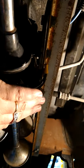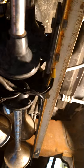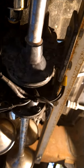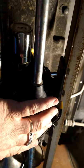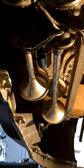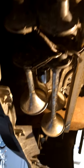It's wired back up real simple. Both of them, you just run the ground wire to a ground point right here, and then the two positives I have running up to a relay. The relay goes to the factory horn positive, so the factory horn sounds and all of these sound, and you get true battery power from the relay — you're not going to starve the horn fuse or pop any fuses.